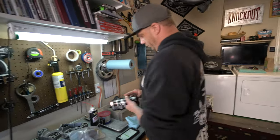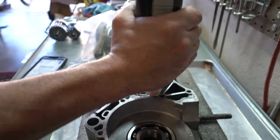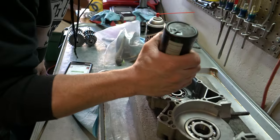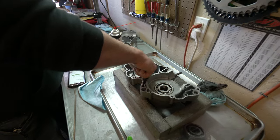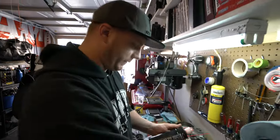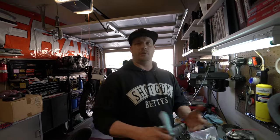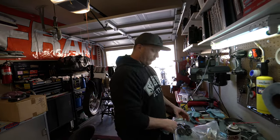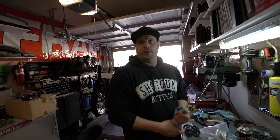I'm confident in your transmission — that looks good. So now we can drop that in. I'm going to throw some assembly lube in here, get it around, and put it in the shift drum dowels and fork pins, and also in this bearing. I'm using Torco assembly lube — I build all my motors with this stuff; it's never done me wrong. It's good for breaking in new builds. You can probably run one or two good rides and then flush the transmission fluid to get some of it out. It is thicker so it does drag a little, but I don't like putting in dry parts.